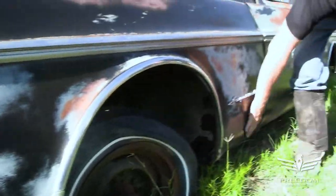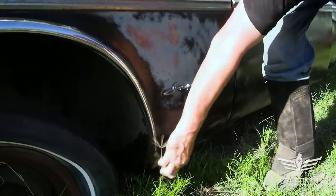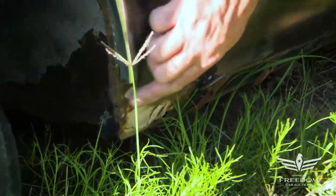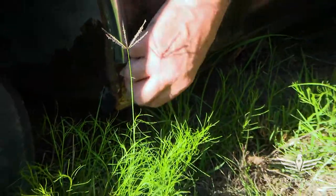Here's the Imperial logo on the fender. The fender looks very good. A little bit of rust down low, and right there we can see where somebody, just on that small area, put some body putty. The magnet sticks here, but just that corner has some putty on it. The magnet does stick, so it's not that thick.